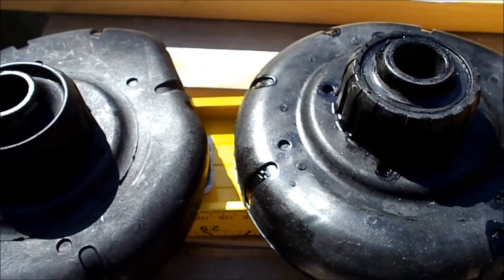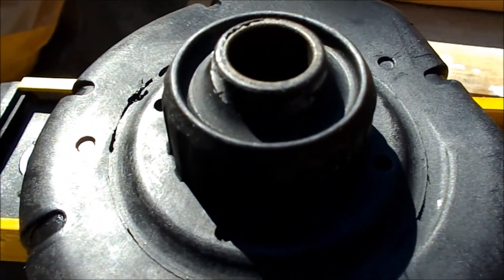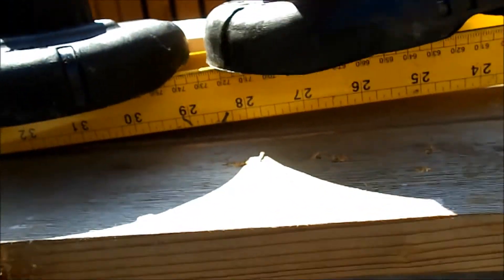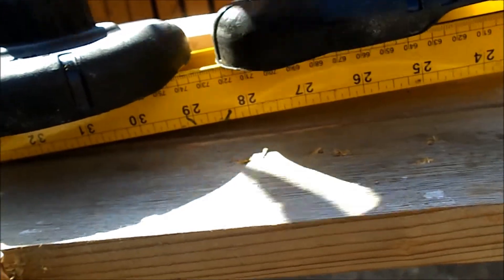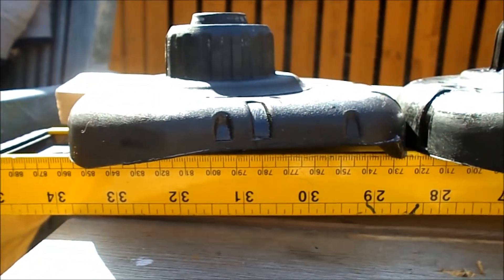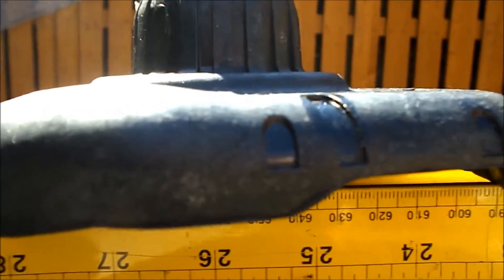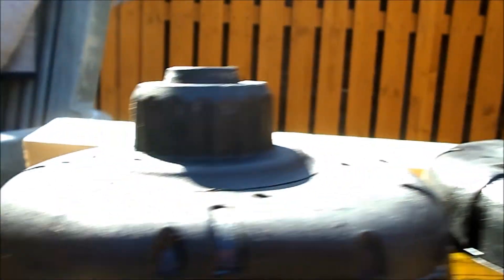This felt about right from holding the items, and a visual inspection shows the IPD has less of a dint point where the rubber sinks around the tube part visible at the top where the strut damper rod goes through. Plus from a side profile there seems more material, a deeper skirt, and looking at the top where the splined rubber features meet the base area, the depth of rubber there is more too — the shoulders you might say. That's it, it is the only heavy-duty version I could find.